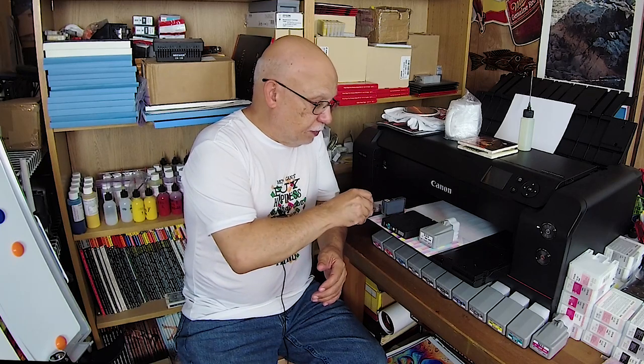So again, no need to be flushing anything. Don't do anything unnecessarily that might cause problems later. A lot of people are having problems drying their cartridges properly. And when you don't dry them properly, the ink will not penetrate the sponge regardless of what you do. So don't create more problems than you can handle, especially as a beginner refiller.